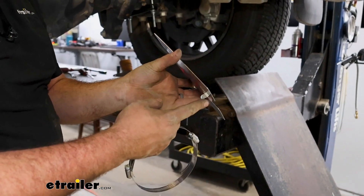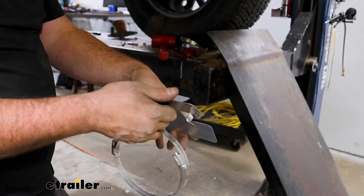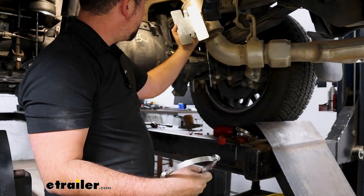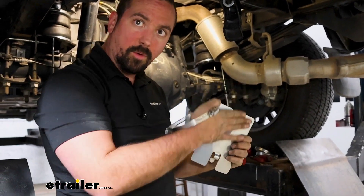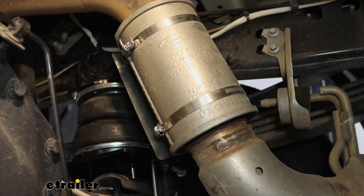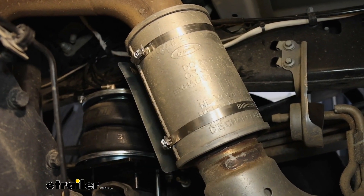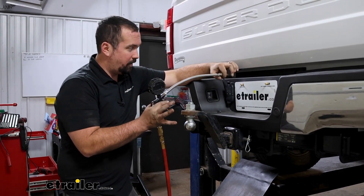To get the heat shield around the resonator, which is the closest spot to the airbag, bend the tabs to give a little airspace between the resonator and the heat shield. Hose clamps are included, but the resonator is large so you may have to double up your hose clamps. The heat shield faces towards the airbag — make sure you have clearance and can pass your hand between the airbag and the heat shield. As the airbag moves, you don't want it contacting the heat shield. If any spot is sitting against the resonator, bend it out so it doesn't rattle.